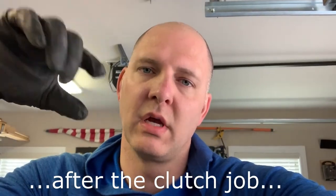Well, I'm an idiot. I'm now correcting something I shouldn't have had to correct because as I was lowering my car, my 4x4 block on my floor jack rolled. I used a 4x4 block to push the car up higher than the maximum extent of my floor jack. When taking it off, you put the same 4x4 block on your floor jack, raise it up, then lower your jack stands a few clicks — not all the way — lower the car onto that, remove the block, raise it back up, remove the floor jacks, and then lower the car all the way down instead of trying to do it all at once.